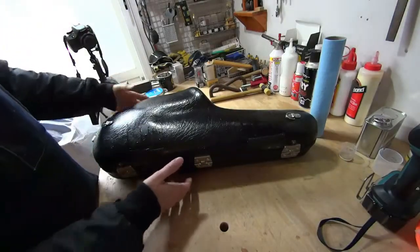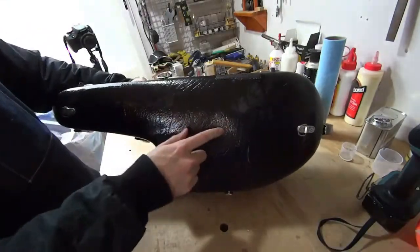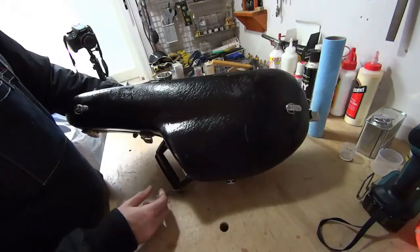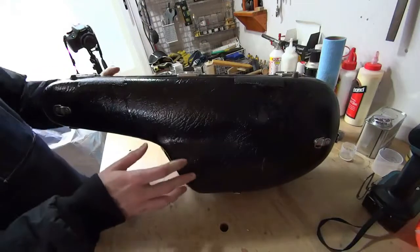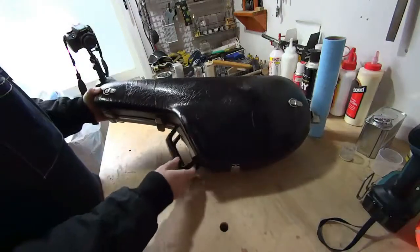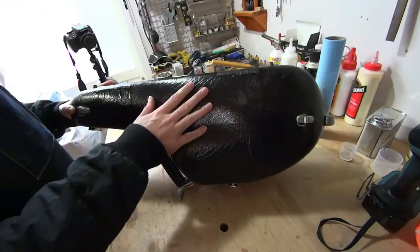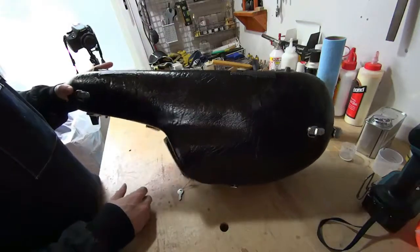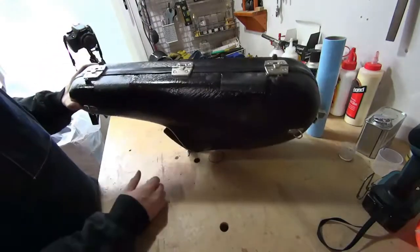So we're back, and as you can see, we've had some complications. It seems that in my haste to upload a how-to video, I have inadvertently created a how-not-to video. And the problem is, if you want to rewind the video back to the place where I mixed the epoxy with the hardening agent, I didn't do it precisely enough, and I didn't have enough hardening agent in. So what should have cured in about an hour or so actually took about 5 days, and it's still a little bit tacky. But that's what happens when you make things or fix things.